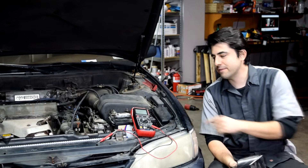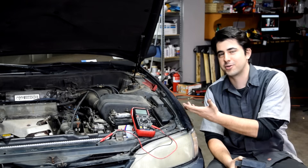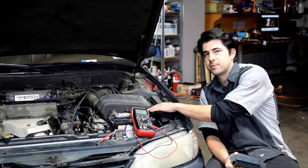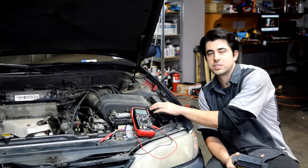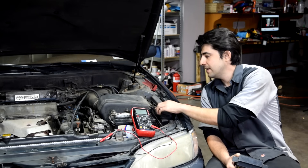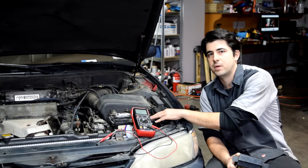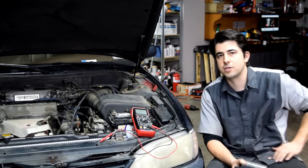For people that don't have a multimeter or load tester — if you can get a jump start and then your car starts, then obviously your problem is your battery and/or your battery terminal connectors. You can replace your battery or take it to your local auto parts store where they'll test or recharge it for you. Then clean your battery terminal connectors with wire brushes or sandpaper, reconnect to your new or recharged battery, and you should be good to go.